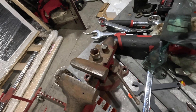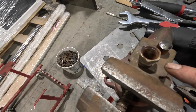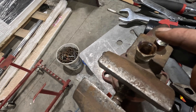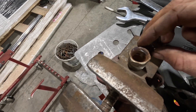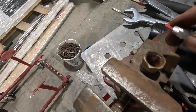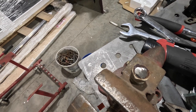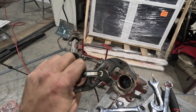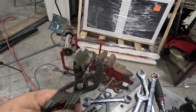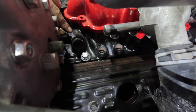Next step is plugging that EGR tube hole. I grabbed an EGR nut from another tube off a parts engine and I'm going to weld it shut. I took some half-inch stock, cut it down, dropped it right in there, and welded that shut. That's our final product — a nice little plug. We'll get it painted and stick it in the intake. Installed. Professional. Kind of.